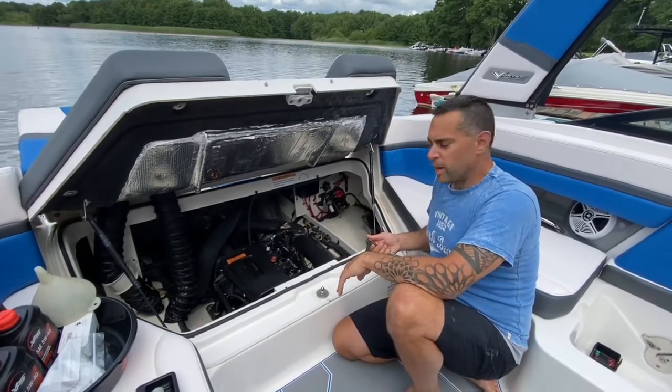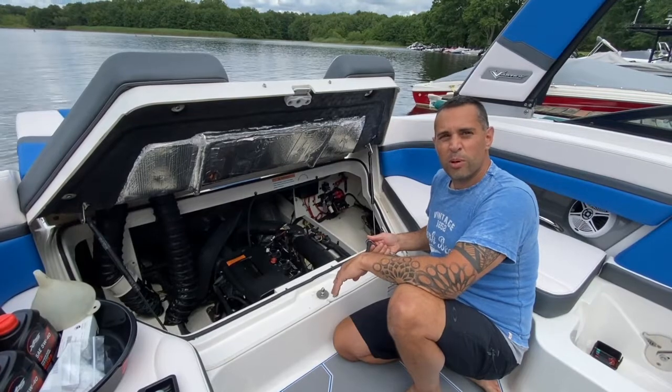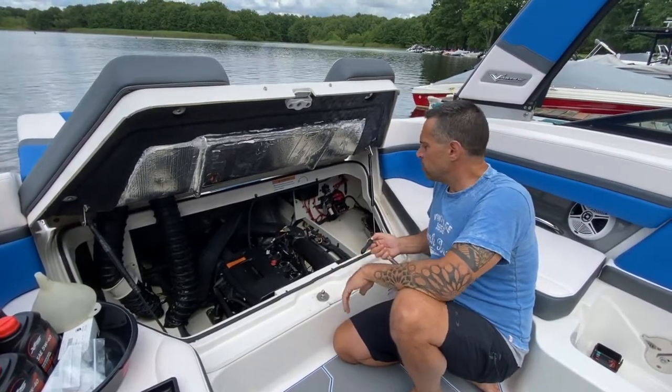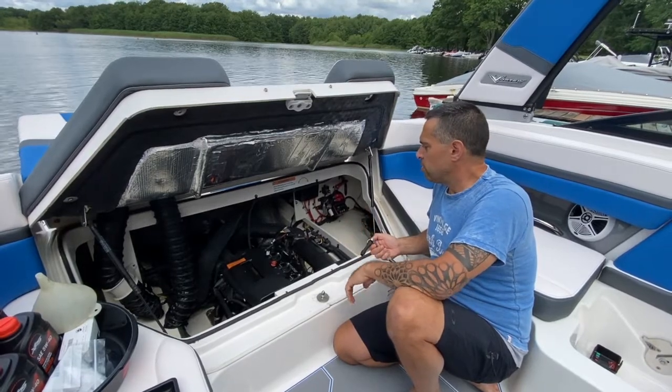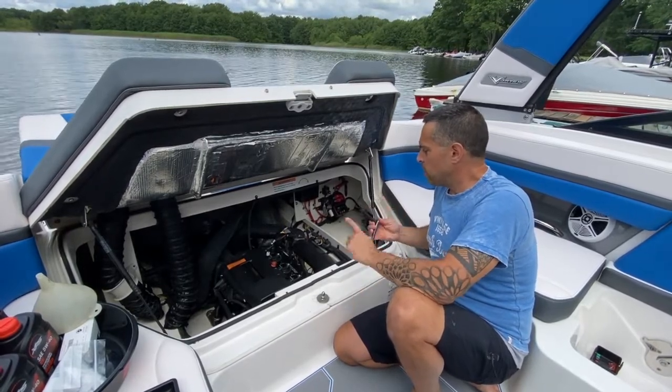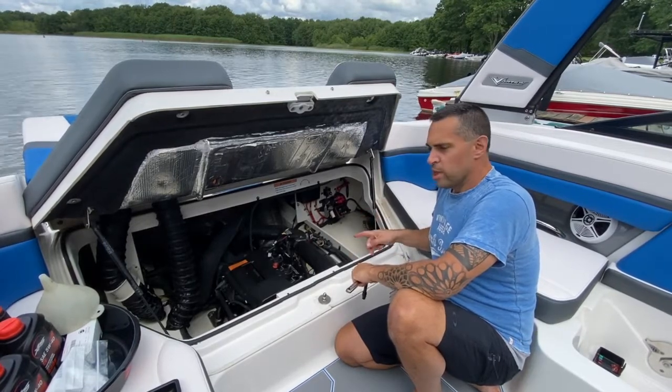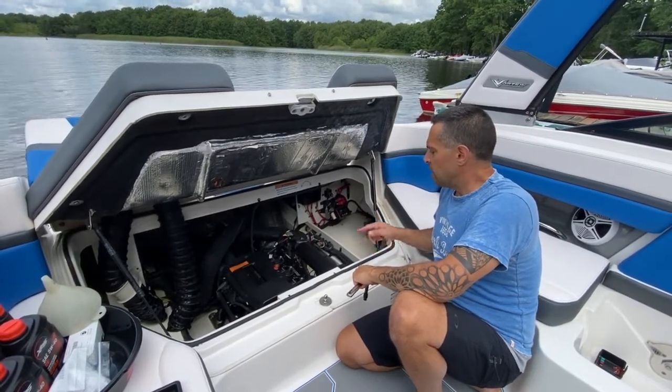But do that about 5 times, and we got out, I'd say, a little over 4 quarts. So the next thing we're going to do is to take off the filter. So I have my spline drive and my socket set ready to go. I'm going to take that off, replace that with the O-rings, and then we're going to add oil.